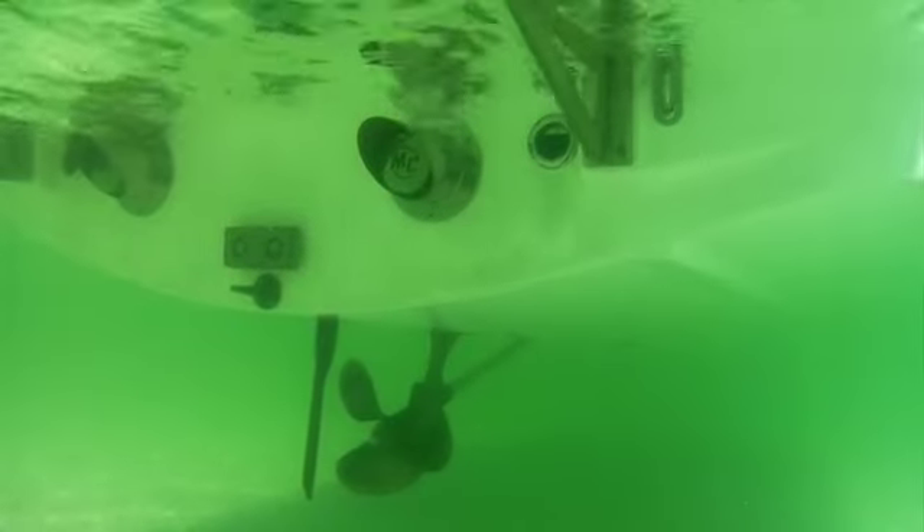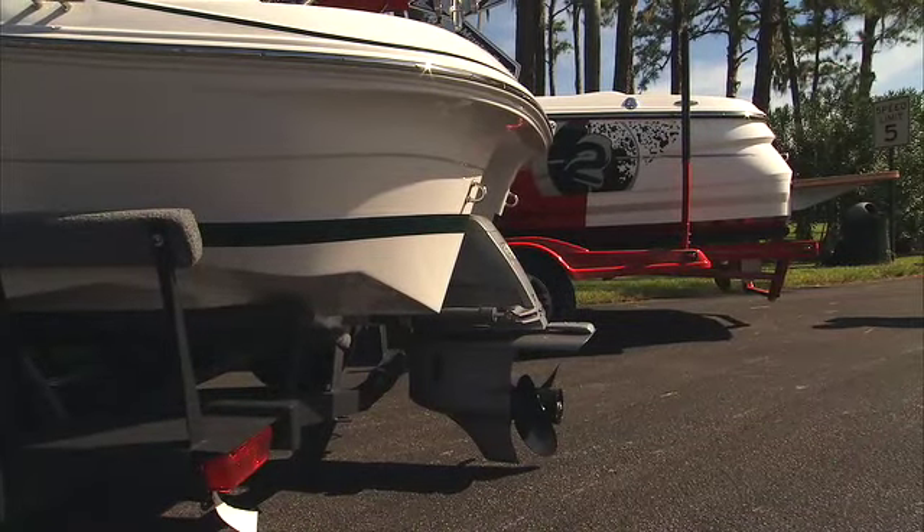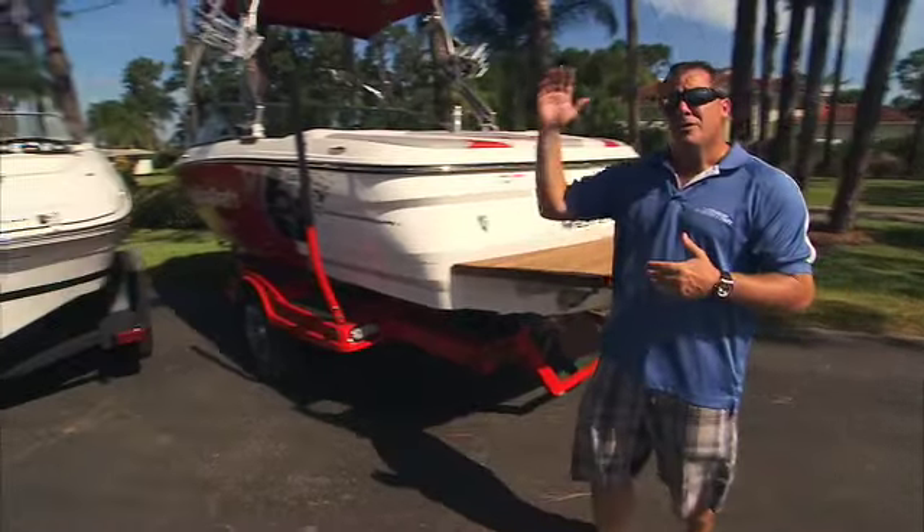What I'm talking about is the prop is underneath the boat versus the prop sticking out two and a half feet from the bottom of the boat, meaning the V-Drive is going to lift the boat quicker. That's going to drag the I.O. out longer to plane.